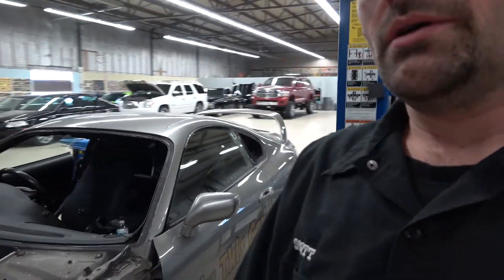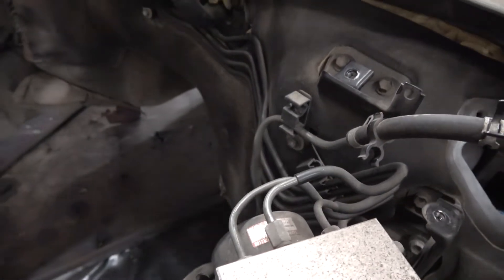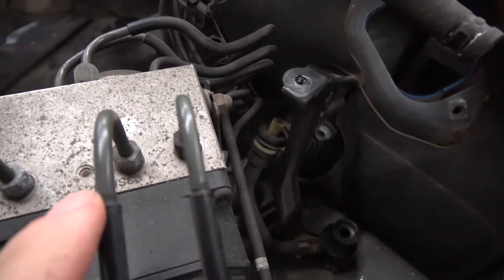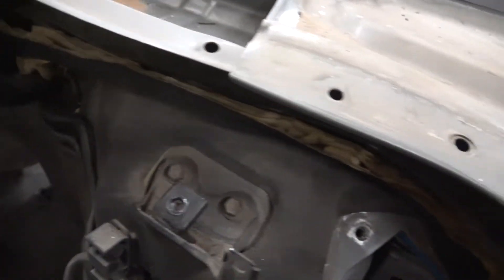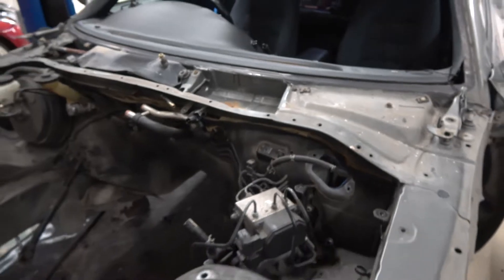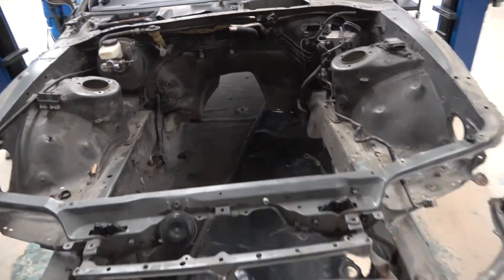Alright everyone, we're back at it again, welcome back to the channel. Another day, I'm going to keep plucking away at this Supra, see how far we can get on it. What I'm going to do is get these bars off, get some tape out, mark up all these lines, and get all of these brake lines and fuel lines off. The lines are almost brand new — only the ends are exposed and the whole line is wrapped in rubber. All of the lines are in really good shape, so I'm going to mark them and inspect them as I go, so I know where they're going when they go back on. Then I'll see if I can get the rest of this engine bay cleaned up, which leaves us with just the interior.